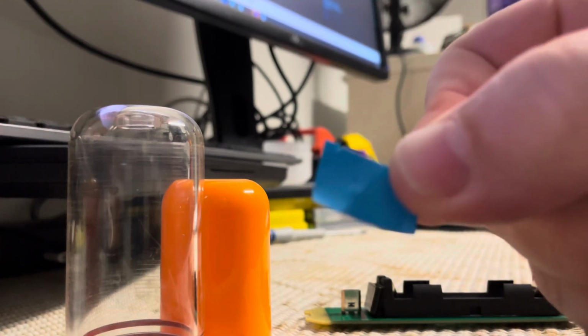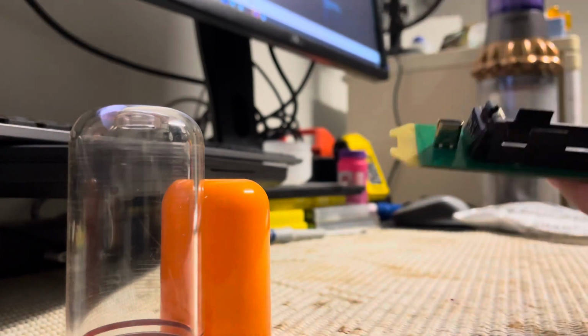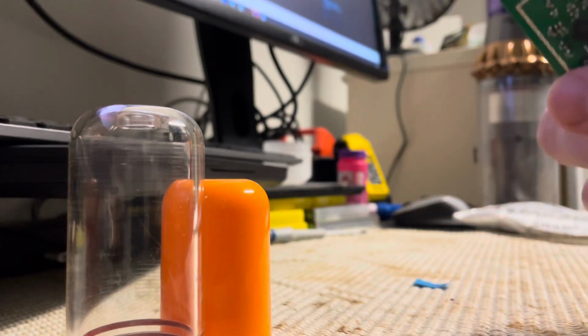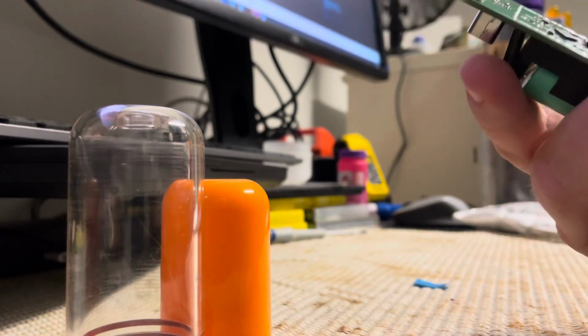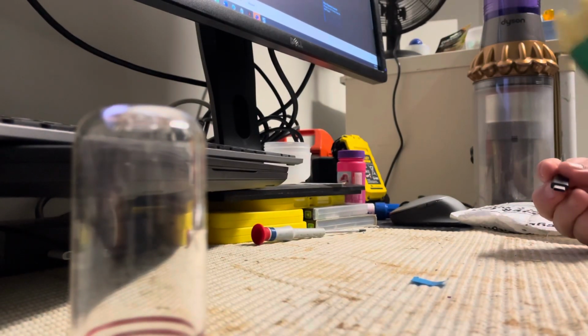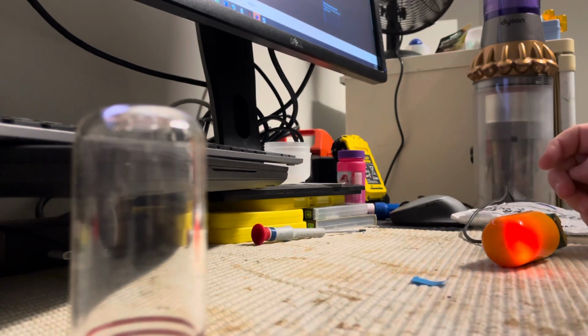Here we go. That's one of the blue tabs there that sits in between the terminals. So rip that one out. They're just like those kids' toys with the little plastic in-seal. They're designed to just pull out. So pull that out and chuck it on charge for 24 hours. Other than that, it's a fairly solid unit on the inside. I didn't really want to handle it too much because with a computer background, I know that if you handle these circuit boards too much, you can possibly short them out. I'm not sure if this is still the case with these, but here we go, and I've plugged it into charge, and we'll see how it goes.